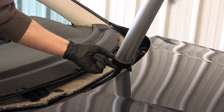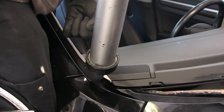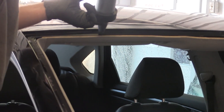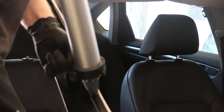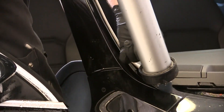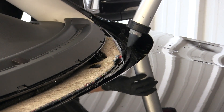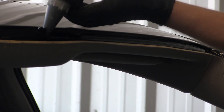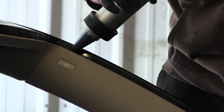Allow the pinch weld primer to dry for about five minutes, then you're ready to start using urethane. Vern just got back from a glass school and this is what they recommend there — it's a Dow product from DuPont. When applying the urethane, you want to hold that gun at a 90-degree angle to get the correct bead height for the car. This gun makes it a lot easier and faster than the ones you have to squeeze. You go around the entire old urethane strip applying a new bead. You want to be careful not to put too much — if you put too much it might squeeze through and show on the inside. You just want a nice bead.